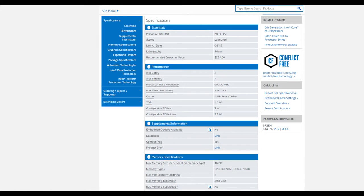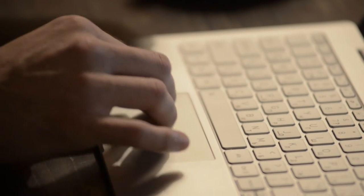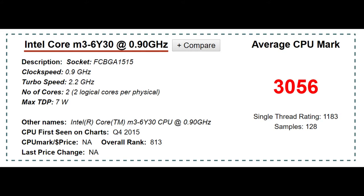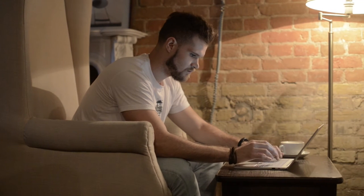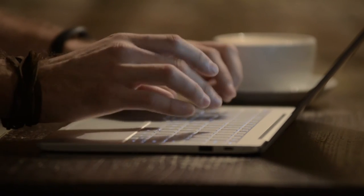The 12.5-inch version has the new Intel Core M3 6Y30 processor that boosts up to 2.2GHz and does not need active cooling as it emits only 3.8W of heat. The CPU is also really fast — it's almost as fast as a full laptop i5, scoring 3056 in the CPU benchmark test. It does throttle at full power after some time, but still holds up to be really fast.